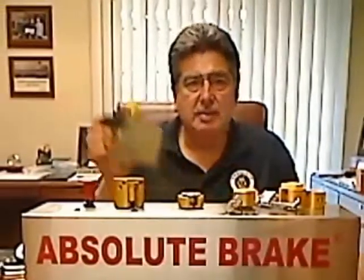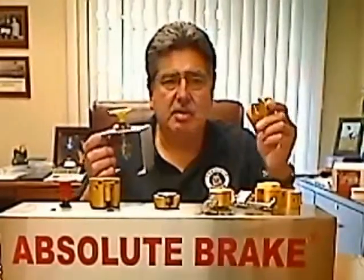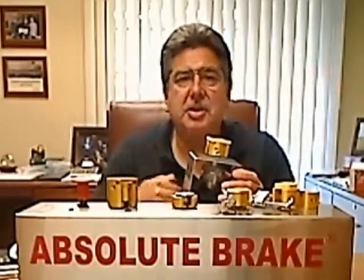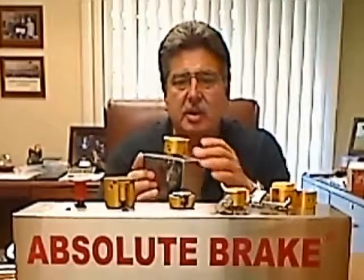What I wanted to do real quickly is show you how easily it's applied. As an example, I will use the AB200L on a PP1 Bendix unit. You take the unit, put it against the shaft of the push-pull valve, and swivel. You must swivel on, must swivel off. If you don't, it's very difficult to get it on and off. I can't emphasize enough: swivel on, swivel off. Most complaints come from people who don't understand that, and they think they have to return it when actually all they have to do is swivel it on and swivel it off. So now the valve is secure. You can move around the vehicle freely and not worry about the brakes being released.